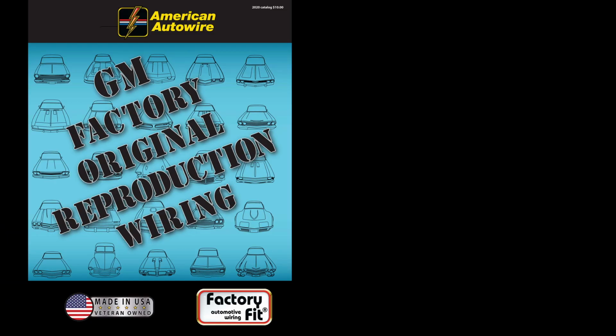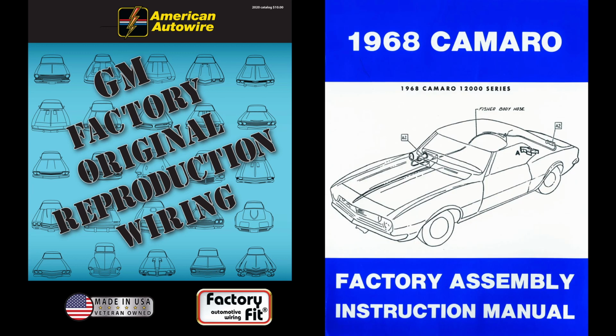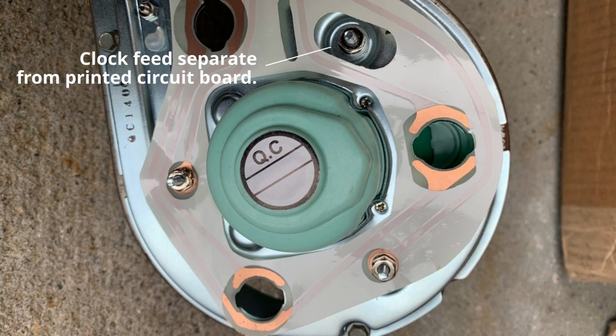Customers with either factory fit or classic update wiring can reuse their original printed circuit board for their gauges. A close inspection of the back of the gauge shows the clock portion does not share any connection with the printed circuit board. Instead, it will receive power from a dedicated battery feed built into the dash wiring.